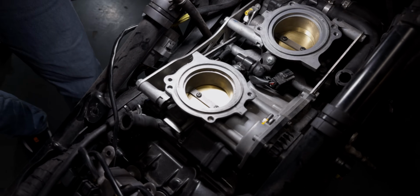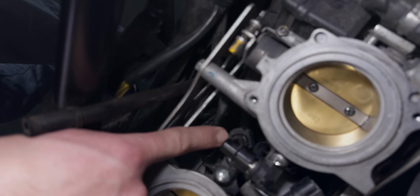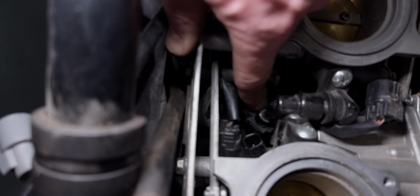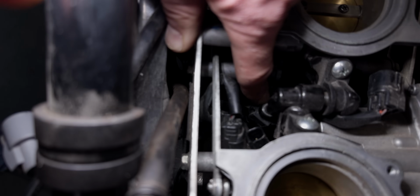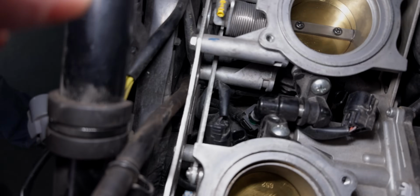Here is the fuel line. This is the fuel line which we took off earlier at the bottom of the fuel tank. Oh, it's the same connection. You can see the green connector. Yeah, I need to press it from both sides, and then it's just clipping off. So this is undone already.